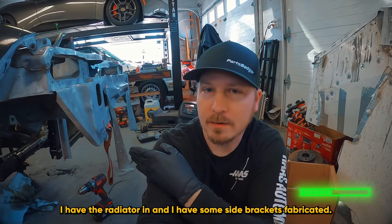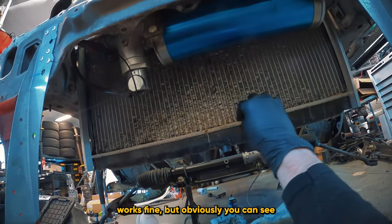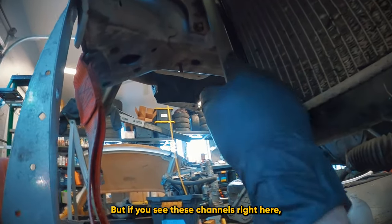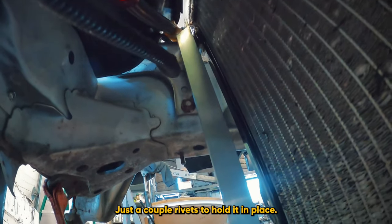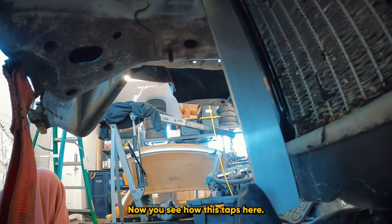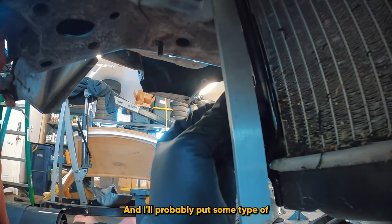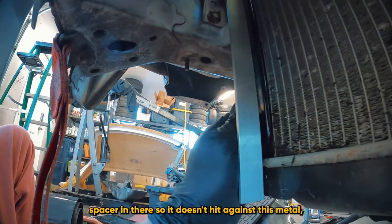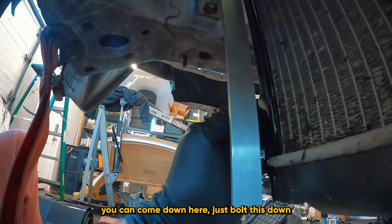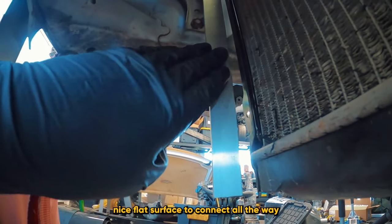Making some progress — I have the radiator in and I have some side brackets fabricated. This is the front view of the radiator. I have a spare radiator here from the Parts Badger car — it works fine but the fins are bent, so I'm going to put a new radiator in and move this one to the spares. You can see these channels right here — I connected those to the mounting brackets with just a couple of rivets to hold them in place, and when the radiator's bolted in, it bolts this down. What I want to do is connect this hole to this face, probably with some type of spacer so it doesn't contact the metal, and then put some weather stripping in so when the radiator's put in place, you just bolt this down and get a nice seal.